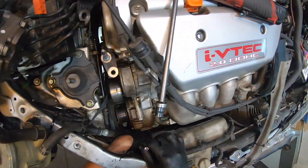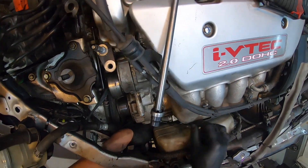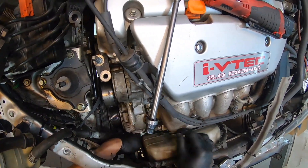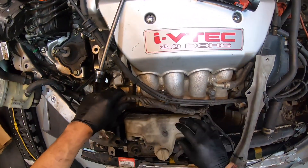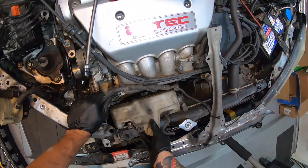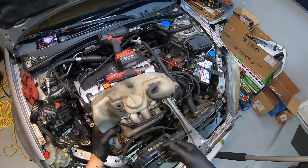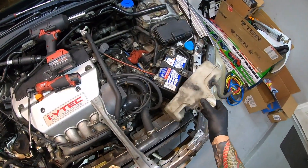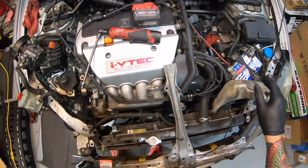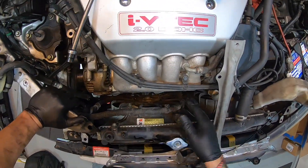Removing the headlight gives you a chance to clean anything or replace anything that needs to be done. It might seem like you're doing more work, but you're not struggling nearly as hard. Working with technicians, I've seen them not want to take things apart and just struggle all day with it. Let's get the cooling bottle off to the side — don't want to spill it. Now we can remove the fan, and this will give us even more room.